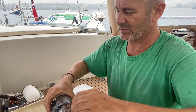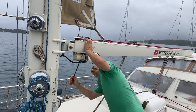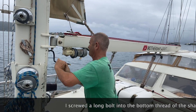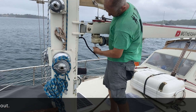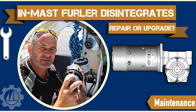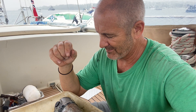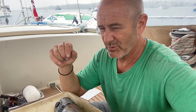You can actually take the brushes out via the inspection hole here, so you can empty any loose carbon out, but it doesn't actually take the carbon off the motor itself. So I've decided to bite the bullet, take the whole thing off, and give it a whole clean — this one's 24 years old now. I'm trying to keep it going because I've invested so much money in it, so I'm going to give the motor a clean and hopefully restore it back to its youthful self.